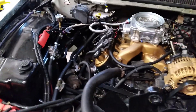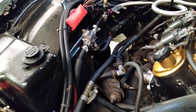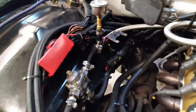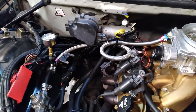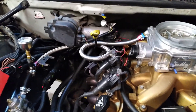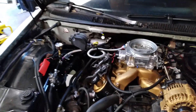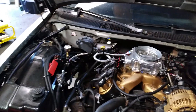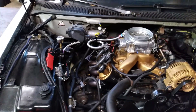This is how it came out. We got our fuel coming direct from the tank to the Holley bypass regulator, that goes to our fuel pressure gauge, and then we got the braided steel line running to the carb. I put a loop in it so we can drain fuel out and change whatever fuel we need to do — makes that a lot easier. Pretty happy with it. We're about to fire up the fuel pump and make sure we're not having any leaks.